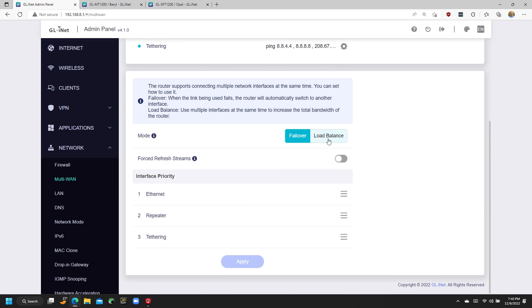The other option available in version 4 firmware is load balancing, which takes all your internet traffic and splits it over multiple different devices — some going out through ethernet, some through Wi-Fi, some through your tethered cell phone, hotspot, or USB modem — giving you additional bandwidth than you would otherwise have. You may want to be careful with load balancing if you're doing streaming, as that doesn't tend to go super well.